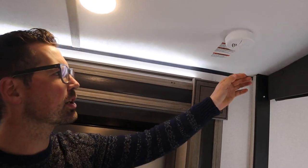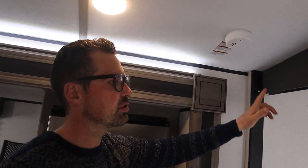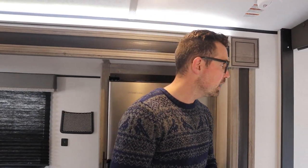There's also a smoke alarm, which is a separate detector up near the top. This is NOT plumbed into the trailer — it has its own nine-volt battery that you've got to check every six months. If the propane detector goes off, you go outside leaving the door open and shut off your propane — that's all you do, then call somebody. Don't sniff around for leaks; just get out of the trailer, leave the door open, and shut off the propane.